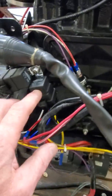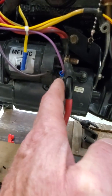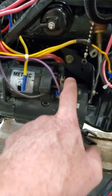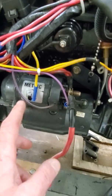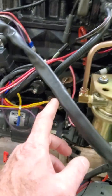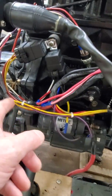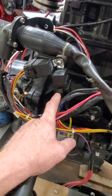For the ignition circuit, I took the ignition wire — I come off of that purple wire and ran around. Luckily on this engine there is what's known as the ignition bypass circuit on the starter solenoid. When the starter solenoid plunger comes up, it makes contact with the battery cable. This energizes the solenoid — that pulls it up, makes contact with the large terminal which sends power into the starter, but it also makes contact with this ignition bypass wire, which sends power up to the positive side of the coil so you get the hottest coil voltage during cranking. So I'm taking that purple wire from the key switch and running that up through my pressure switch, and then that goes out my white wire into the relay, which energizes the relay.